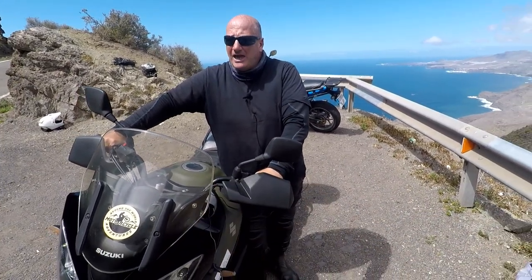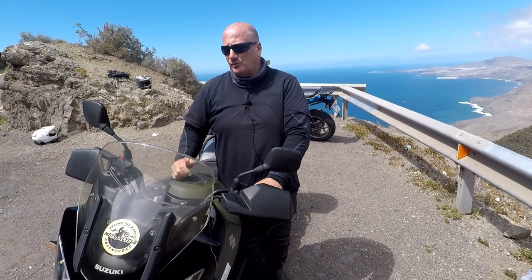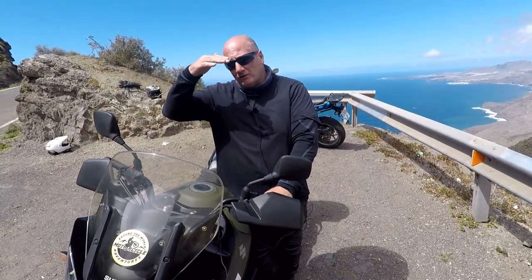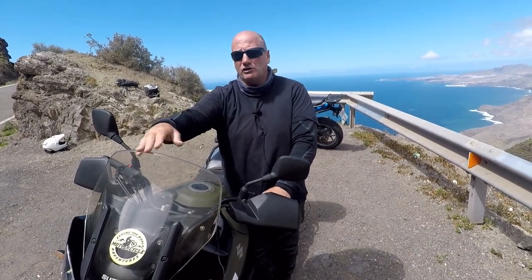The windscreen, well, I'm a little bit short, so when I do start picking up speed, certainly on the motorways and the autopista, I do get a little bit of buffeting on my forehead. What I've done is I've ordered a new screen for it. It's going to be a touring screen. It's going to be a little bit higher, so that should send everything over my head.